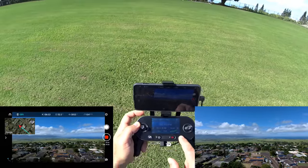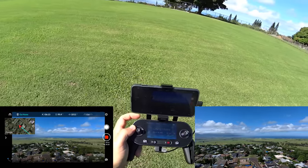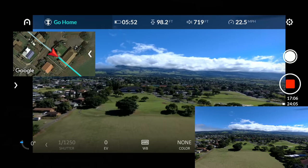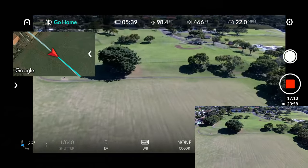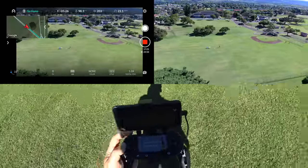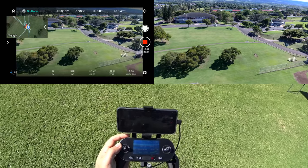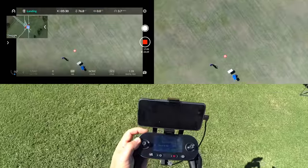Holding return to home on the controller - the blue bar is going up, I hear a beep. I want to let it come home and do a precision landing. We're still in ludicrous mode. Checking how fast it's coming back - 22 and a half mph. That's kind of the default return-to-home speed in all modes. I'm rotating the camera as it comes home. Tapping on the top bar: visual obstacle avoidance is disabled during landing, same thing DJI does. And we see 'accurate landing correcting landing location' pop up on the screen.